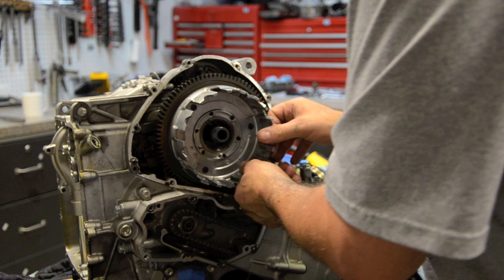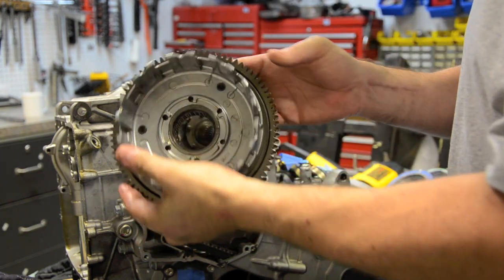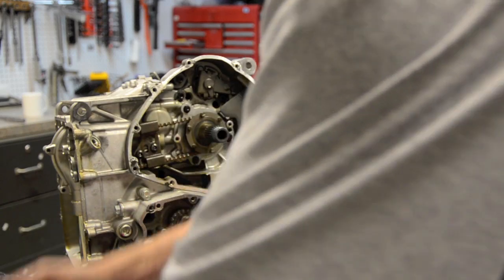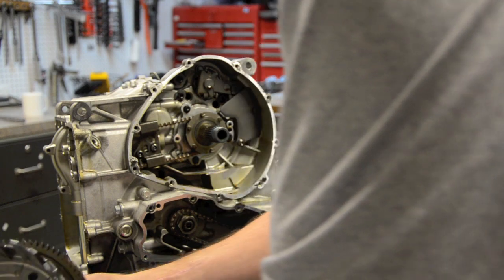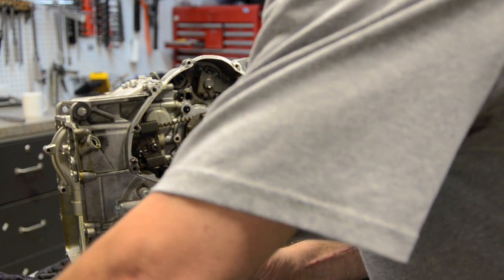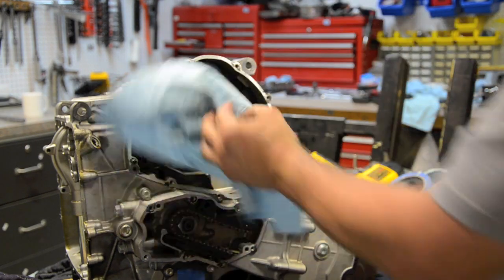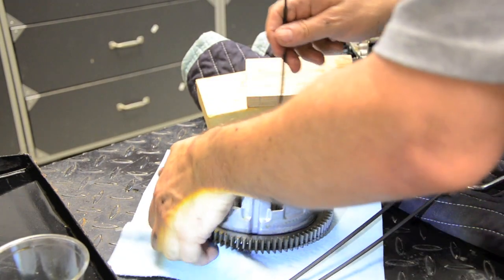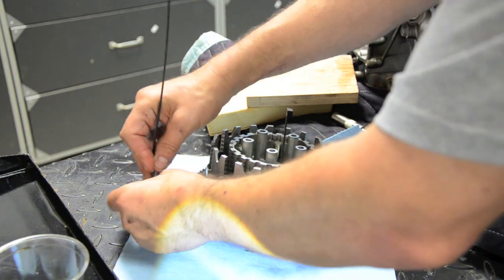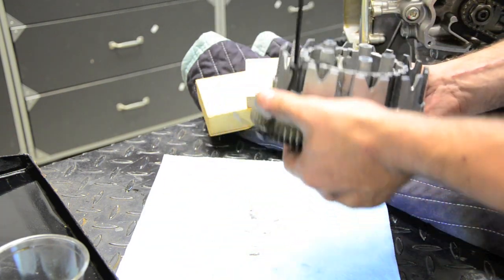Let's see what's holding this one in — it's just heavy. It looks almost like a traditional clutch. He's out. There's the big bearing that sits in it — a big center bearing. That's the bearing sitting in the bearing housing. There goes the washer, there goes the clutch housing. I'm going to zip tie all that lot together in the order it all came out. I'll run a zip tie through to keep all the parts in the order they came out — looks like I'll need two zip ties. That keeps the bearing and everything all in place.